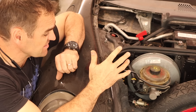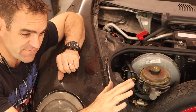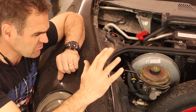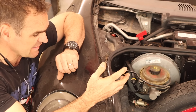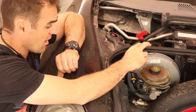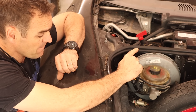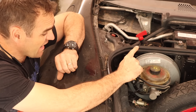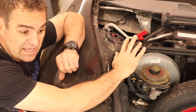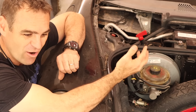The whole time that I've had this car, every time I try and hit the brakes, the pedal felt odd. It basically almost felt, as soon as you touched it, like the pedal started sucking down to the floor - it was a very odd sensation and wasn't working correctly. I went through, bled the brakes and did all that sort of thing, but I don't think that was my issue. I think my issue is with the booster. I tried capping it off last time, and when I jumped on the brakes with the booster completely disconnected, it worked as it's supposed to, albeit a very hard pedal, but it didn't have that odd sensation.